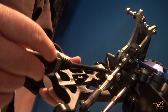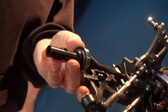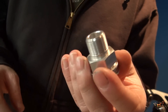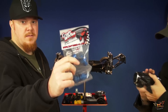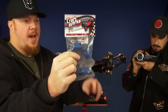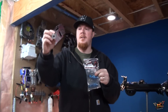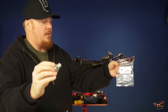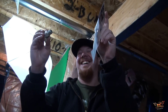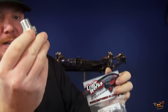On top of that you'd have the hub and the tire. What is that? The Craftworks hub. They have a couple different kinds for the Losi, which is nice. So this is the Losi thread — there are two different thread patterns for the two different models. This one takes the nuts that come stock with the Losi. These ones come with a thread pattern for the HPI Baja wheel nuts. Medic has a set with the other thread pattern, so you've got to pay attention to what you're getting.